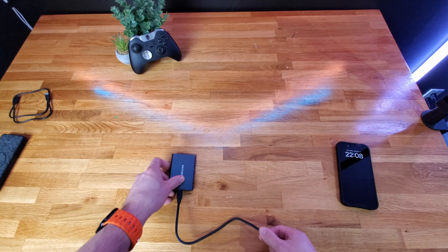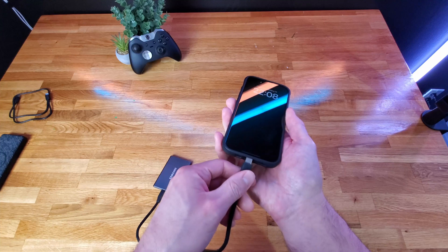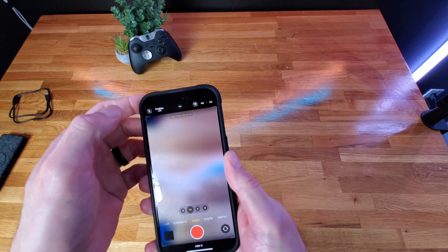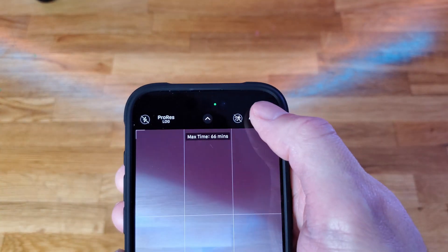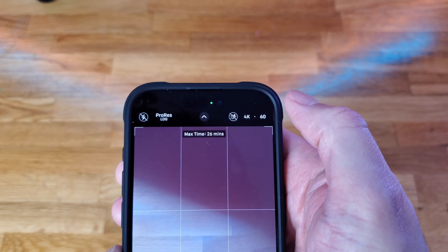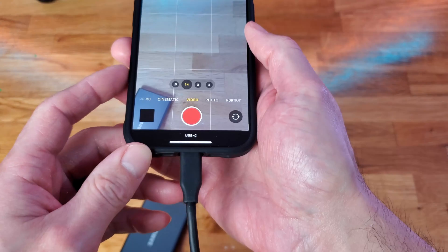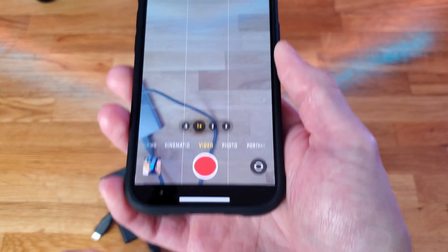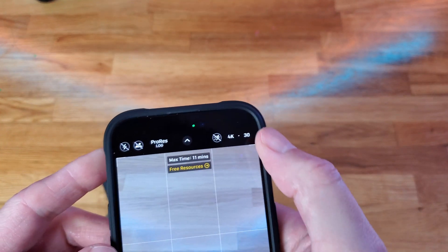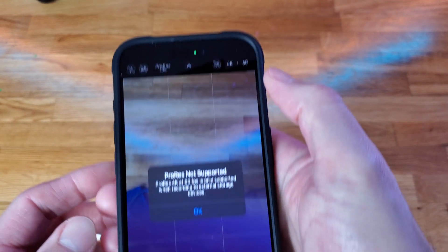Be sure to subscribe to see when I finalize my build. The iPhone 15 Pro now supports ProRes recording at 4K 60 frames per second, but only to an external hard drive. If I take my Samsung drive and plug it into the iPhone, USB-C shows up at the bottom of the preview window. I can now select 4K 60, and it gives an estimate of available recording time at the top of the screen. If I remove the drive, it changes back to 4K 30 and the USB-C indicator disappears.